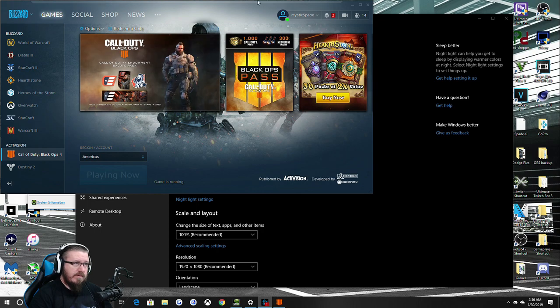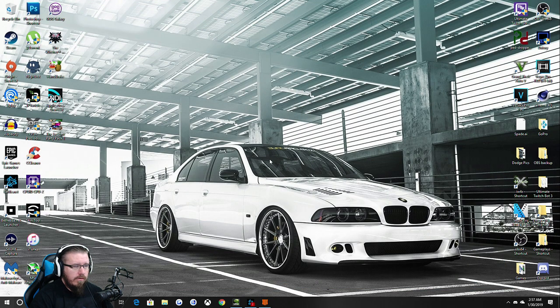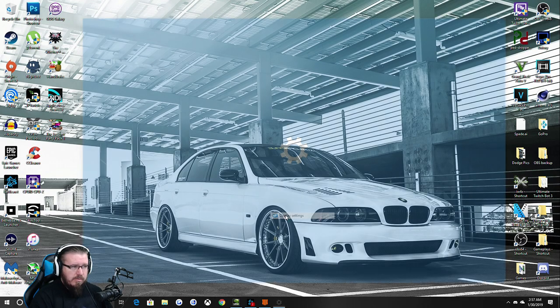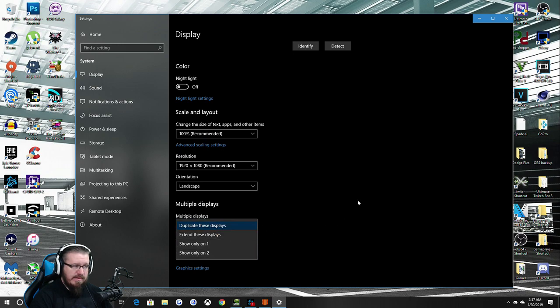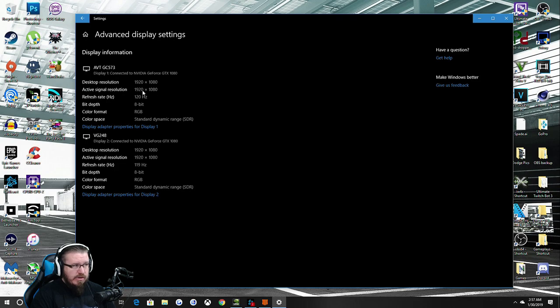I'm going to show you a couple of things that threw me off. Most people, when cloning their monitor, go to display settings and click extend or duplicate — that was the problem, this was causing screen tearing. I'm not sure if this was also causing tearing on the Elgato 4K 60 since that card's already been returned, so I can't confirm it. But whenever I went into advanced display settings, it was showing 4K 60Hz on the capture card, sending the wrong signal even though I had it scaled to 1920x1080.